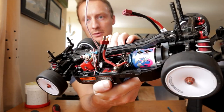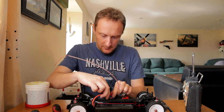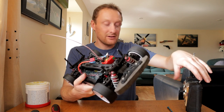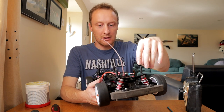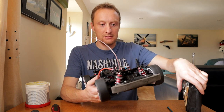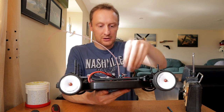There we are - soldered on, everything's good. Time to try it. Steering test. Can't tell if that's any freer than it was before. I mean theoretically it should be - now it's got ball ends everywhere rather than just rubbish fittings. It's easier to move by hand, it's smoother, and there should be no binding. So theoretically that's better as well. But the most important thing is - does it sound smoother because of a straighter drive shaft?